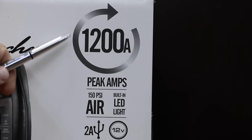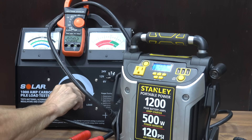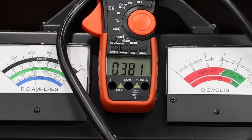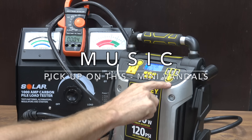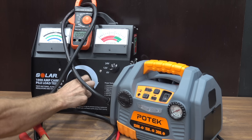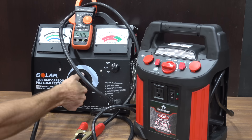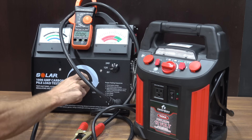All manufacturers make bold claims regarding jump starter cranking amps. Using a carbon pile tester and clamp meter to measure peak current, all units are fully charged. The Stanley, rated for 1200 peak amps and 600 cranking amps, made it to 388 amps at 4.4 volts before suddenly powering down and smoking — it no longer functions. The Potec, rated for 1500 peak amps, made it to 404 amps at 4.8 volts before also beginning to smoke. The Cosway, rated for 1500 peak amps, performed by far the best at 445 amps at 6.6 volts and survived the test without any visible damage or smoke.